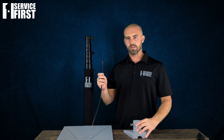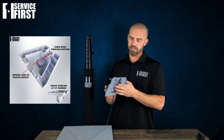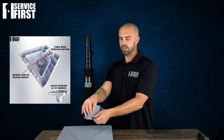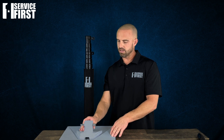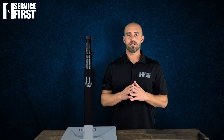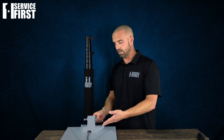The first thing you're going to want to do is take your RJ45 Starlink cable and put it through the opening slot right here on the adapter. Now that it's through the inside, go ahead and push it through the notch here in the front, and then you can go ahead and clip your RJ45 into the Starlink. Now simply slide your adapter into place until you hear it click. To remove the Starlink adapter, simply put your two fingers underneath and push upward slightly and pull back, and your adapter comes out.